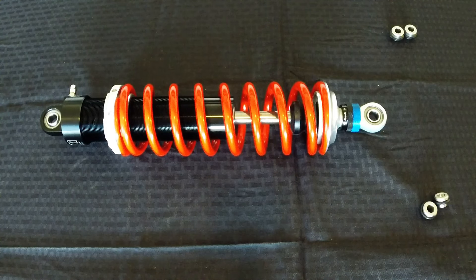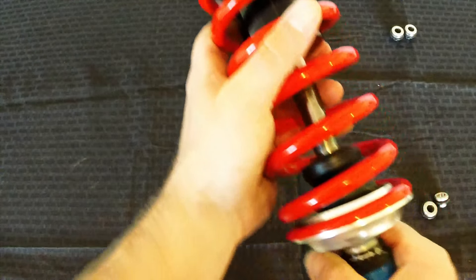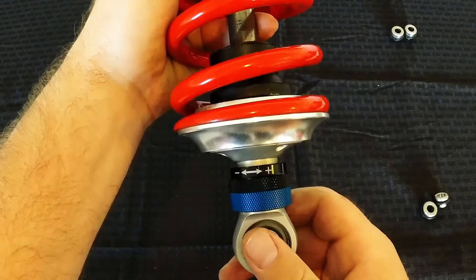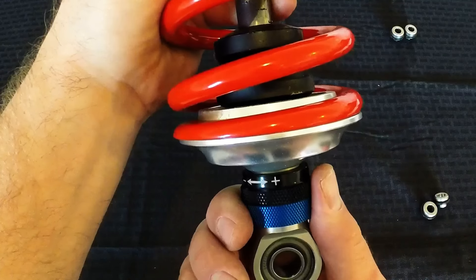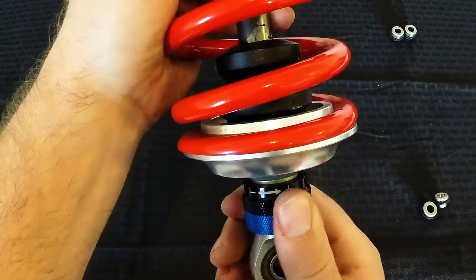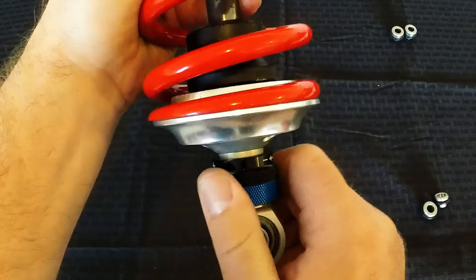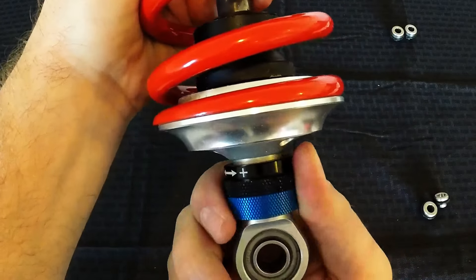You can call it whatever you want — I just don't want there to be any confusion. To adjust the compression damping on these shocks, there's an adjuster at the bottom of the shock that you can turn by hand. Click by click you can make damping softer so that the slingshot deals with bumps more like a softly sprung car, or you can turn the adjuster the other way to stiffen the ride for track days or performance driving.